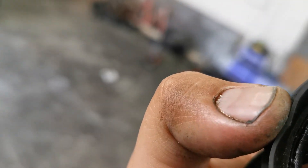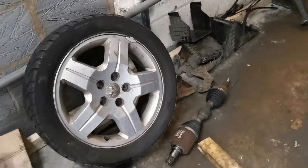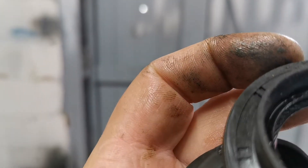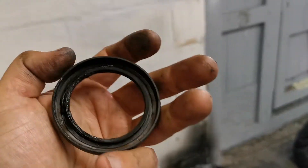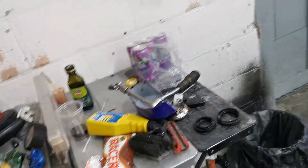The seal code on the short drive shaft on the passenger side here in the UK is MT050A14. The other one, which is thicker, is PH6542F — something like that. I took a screenshot when I was Googling it so I'll post a picture because I have a better reading on that one.